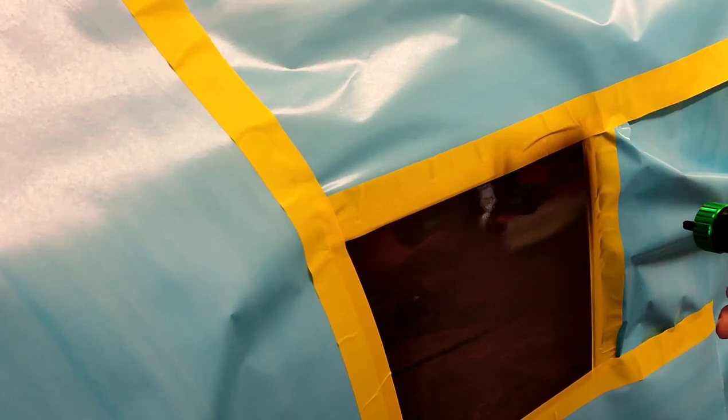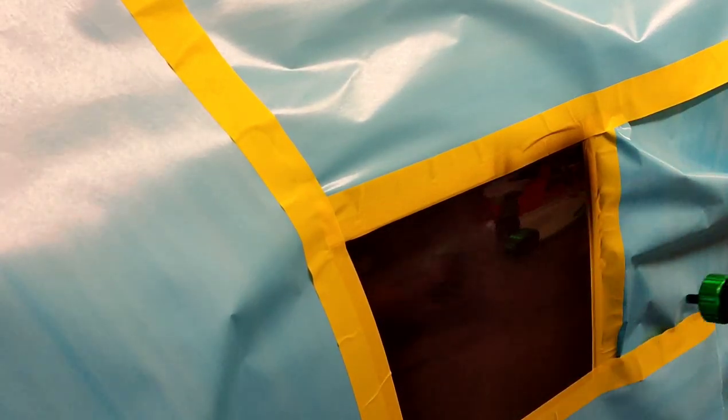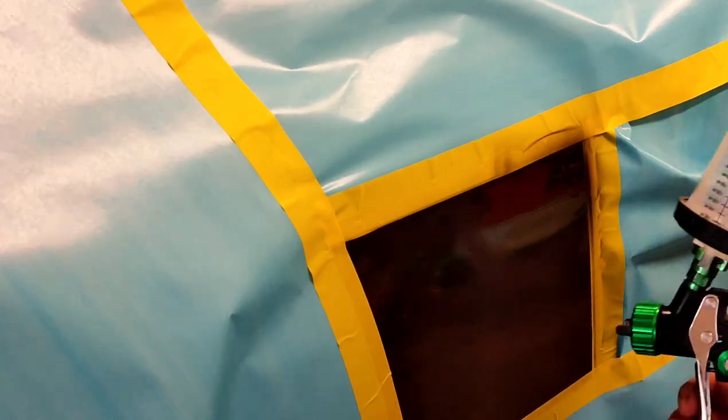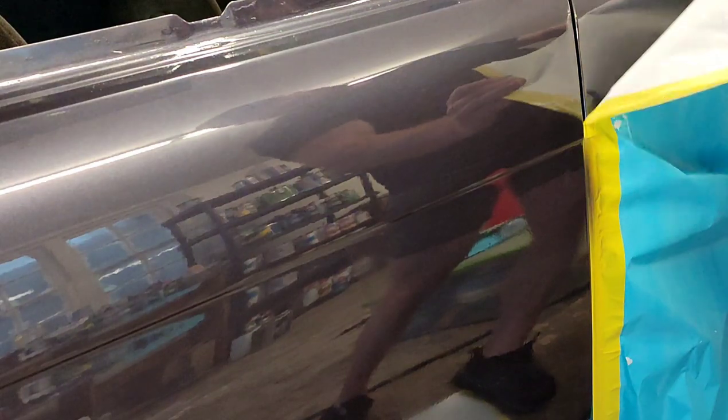The clear coat's done — everything laid out pretty good. Now we're moving on to the blending phase. We're going to spray that dry, crispy overspray you get when you stop the clear coat in the middle of the panel — spray that all down with your blending solution, get it kind of wet but not too wet, and then untape it. And you're pretty much done. As you guys can see, we got a really, really good spot repair.